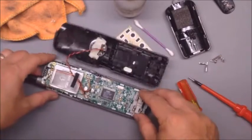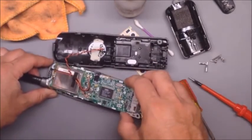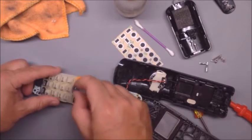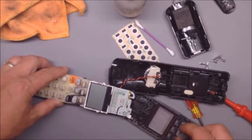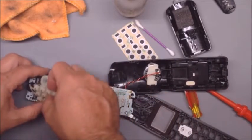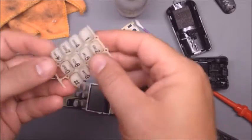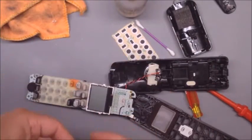Now that we've gotten that apart, just pick up from down here where the battery contacts are and lift it over like that. We've got this silver volume button — I'm going to pop that out, make sure it's not gunked up with dirt, and put it right back. It's got a skinny spot at the top so it can't go in upside down. The plastic keycaps came off with this. If there's any old spill in here it might make the buttons sticky, so you might want to soak it and clean it up with rubbing alcohol and a toothbrush, or soak it in hot water and soap.